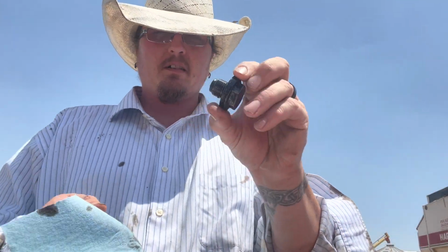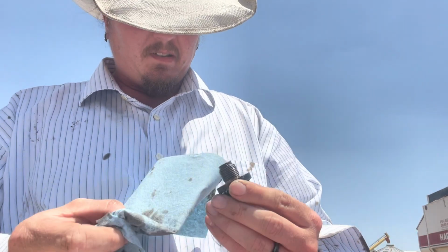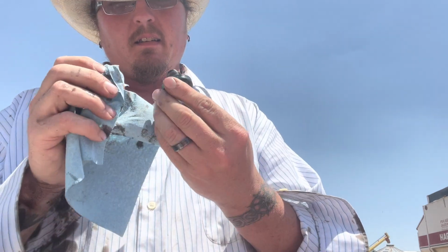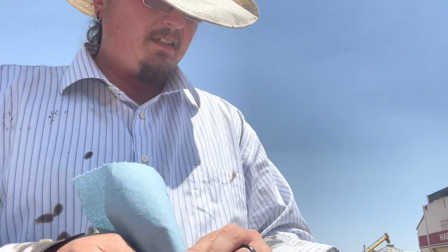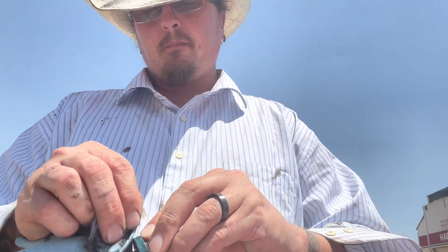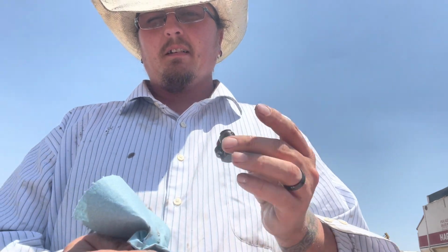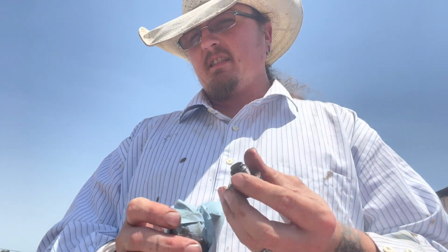All right, first thing we're going to clean up is our drain plug. Always want to make sure it's free from any bit of dirt, grease, debris. And then I also check the end of this because it's magnetized. Make sure I get no steel in there, which we're good. Our little gasket, the seal, is still good. But now we'll go up under the front and I'm going to clean off the pan around this, where this goes. And then we're going to seat it back in there.